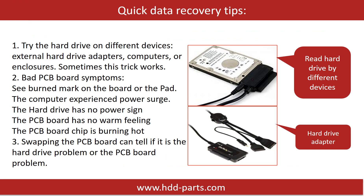There are some simple ways to recover data from a hard drive. One of them is to try to read the hard drive by different devices, like different external hardware adapters, computers, or enclosures. Because different devices use different ways to read a hard drive, sometimes this trick works. Another way is swapping the hard drive PCB board. Swapping the PCB board can fix the problem caused by the PCB board, and it is way cheaper than sending the hard drive to a data recovery firm.